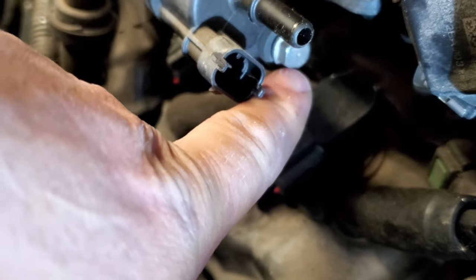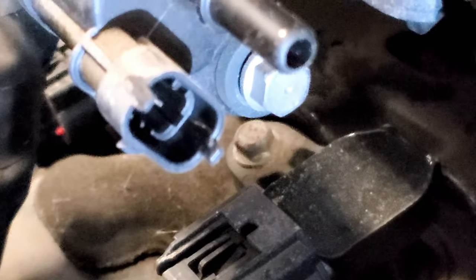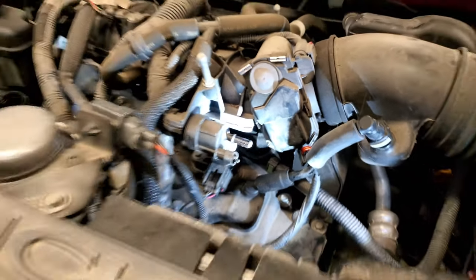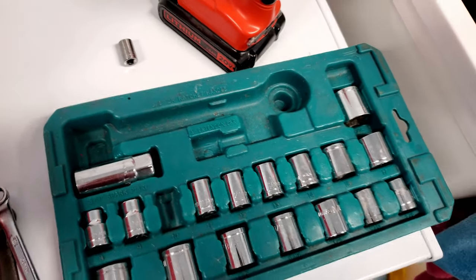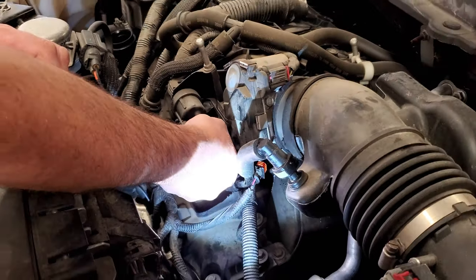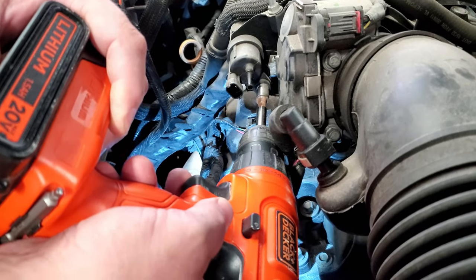The third step is simply to remove this bolt. You can use a vice grip, pliers, or whatever tool you use to remove bolts. I'm going to use a socket wrench set — that's the easiest way to get in there. If you don't have one, you can borrow from your neighbor. The only issue is you need a metric number 10. I found that a 13/32-inch socket is close as well — it has a little play but it's tight enough to do the trick. I chose to attach mine to a drill because it's easier to get in there and back that bolt out.